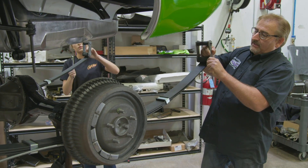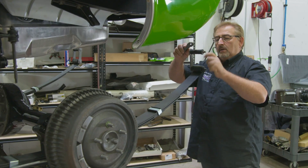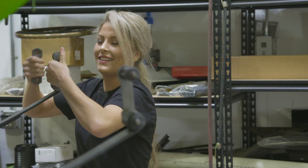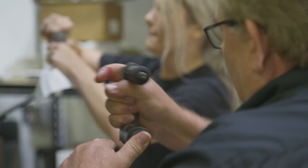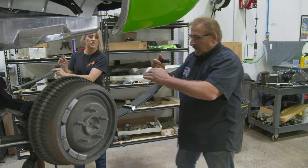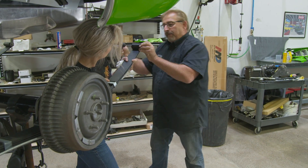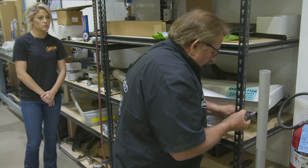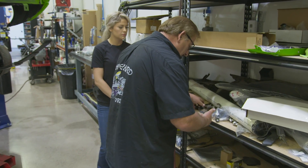The outer shackle brace bracket comes off. Take the bushing off. People hate grease — they put it on the outside but they don't put it on the inside. You've got to put it on the inside. Did Royal put this together? That will not lubricate anything. It just makes taking it apart so hard. You hear that squeaking? That shouldn't happen — there should be grease in there. It's dry as a bone, no reason for that, ever. When you put it together without grease, it'll squeak — that's why we grease them.